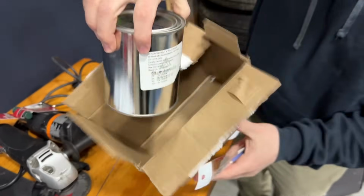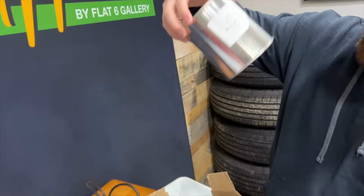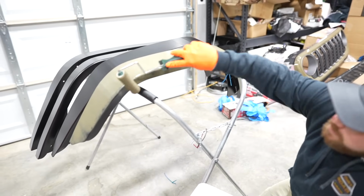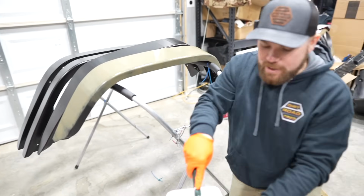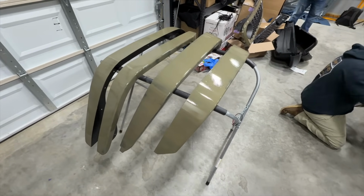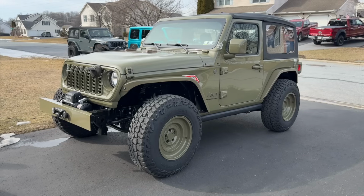After that though, it wasn't over yet. We were able to get the inner fenders on and all that, but we took it one step further and actually rolled on the 41 clear coat paint. Now, we had a local paint shop match that up for us. We took the cowl panel off, walked it into the paint shop. They actually used a laser and a computer to scan it, got it to damn near a perfect match. It's insane how close that was.